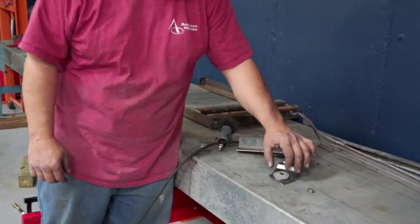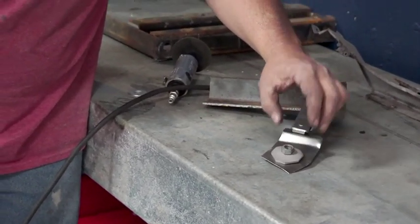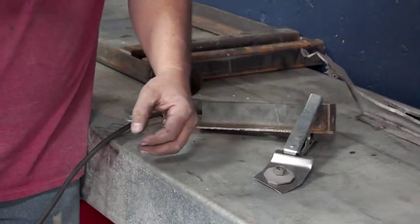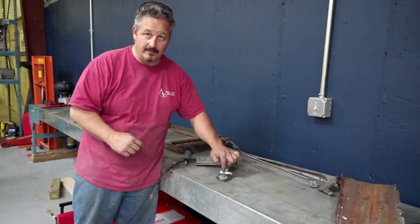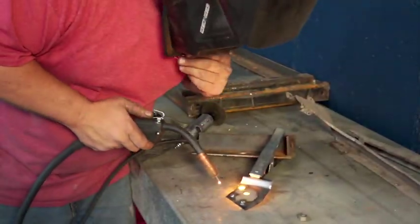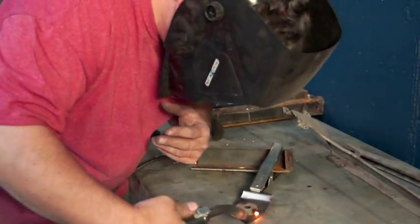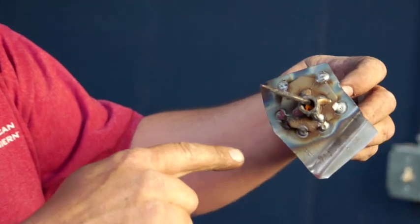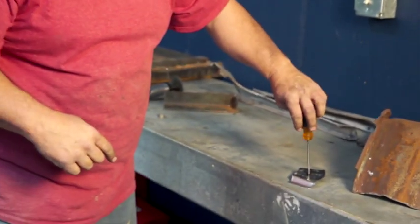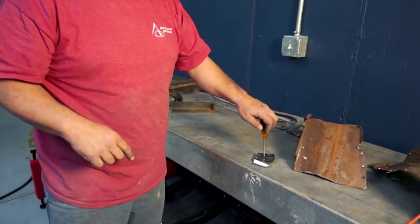We've got the metal here. I'm putting this washer in and welding that in, and then I'm going to weld the nut in like that. That way you've got a brace so when we bolt the body down and weld this panel on, this is going to be behind it — so now we'll have something to thread into. You can see where we tack welded all the way around, got a big beefy washer and then the nut on there. When that gets welded in, we can weld it in place all the way around here and then the bolt will go right through the hole and thread in.